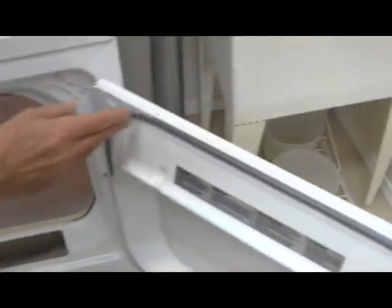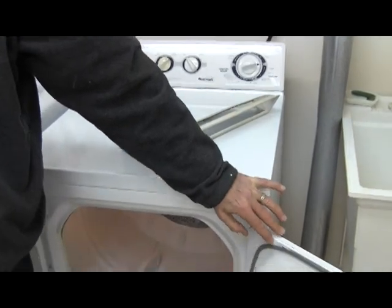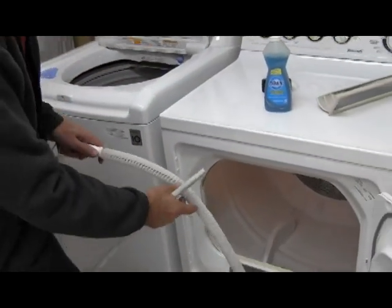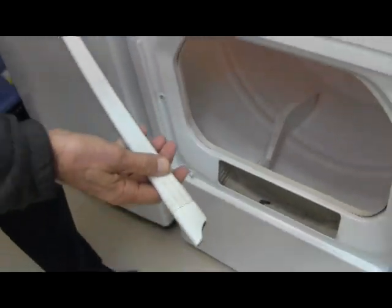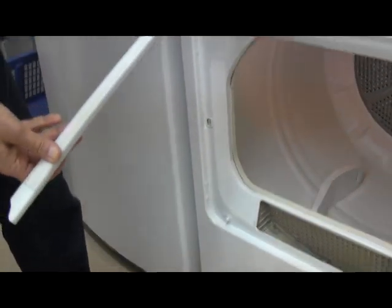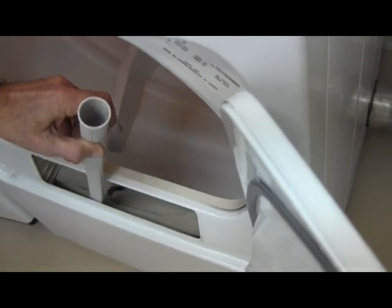With this style of dryer, it's a fairly large throat here and you can see some of the lint in here. Of course it goes further down, which you can't really reach. So we have a couple of tools to clean that out without having to disassemble the dryer. You can get these tools at a vacuum cleaner place. First one is a lint-catching brush, which you could use to shove in this area and move it around to catch lint. The other one is a longer crevice tool — this particular one was 20 bucks at the vacuum cleaner shop — and it can be used to go in here and clean out a lot better into this area.